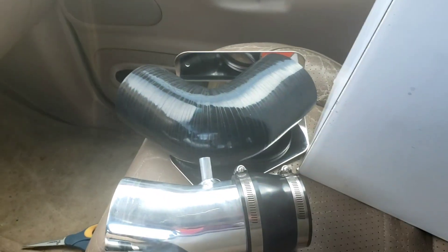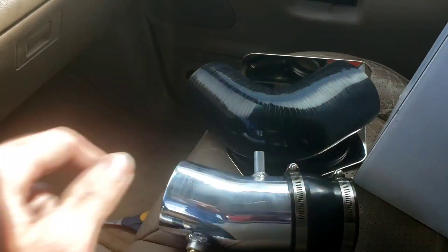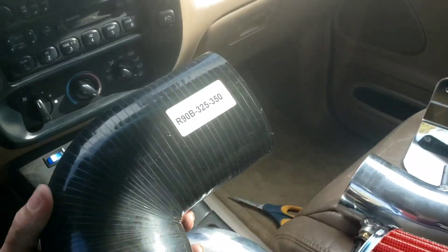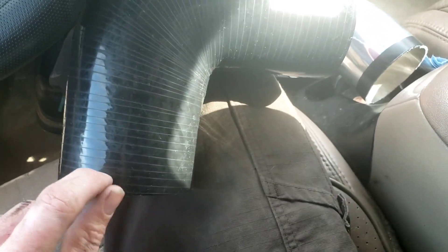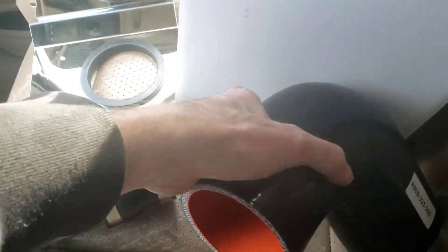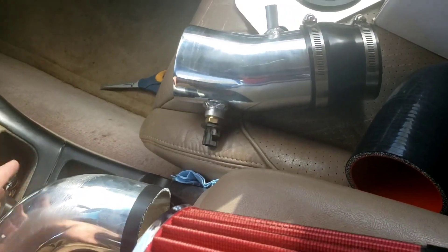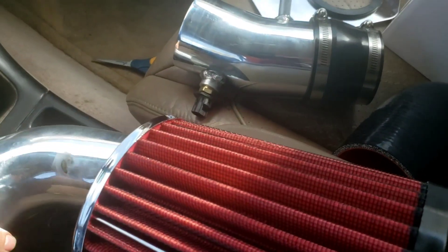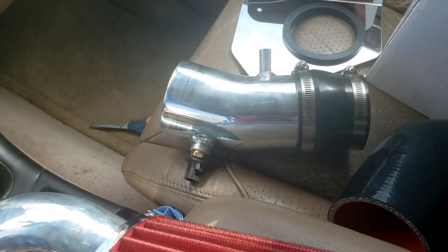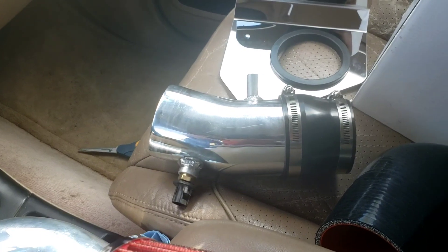It also comes with this big air filter and a flange piece, except that flange piece used to be connected to this hose — I cut that off this morning with the hacksaw. I've customized this kit to fit my Explorer. There's this rubber piece — it's three and a half inches diameter on one end and 3.25 inches on the other end. I bought that custom for this build. I'm replacing the old piece with this because the way it was set up before, it would not bolt onto the Explorer since it was designed for the Mustang.